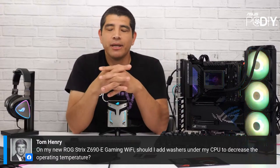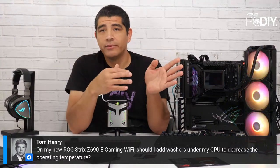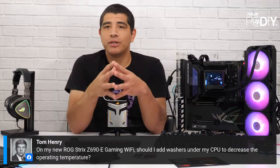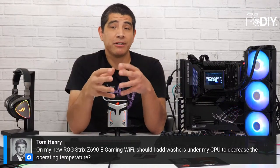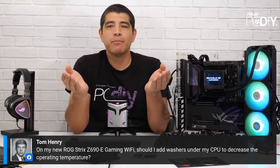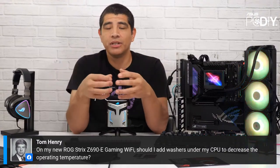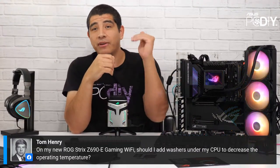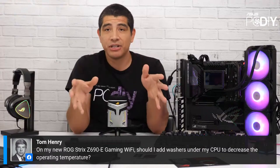I would tell you it's not necessary. The reality is that I think that a lot of the media coverage that has talked about thermal performance on 12th gen series CPUs has done so, of course, with valid testing. But I think that for the vast majority of users, not really real world parameters that are actually going to affect your resident temperatures. And what I would mean by that is that if you're showing temperatures running, let's say Cinebench for 30 minutes or an hour, it's actually fairly irrelevant because of the thermal load that you generally are placing onto a CPU, even if it's heavily overclocked, right? So I'm talking about like 5.3, 5.4, 5.5 gigahertz per core overclocked can be done with a 240 millimeter AIO when you're talking about general desktop usage and gaming.